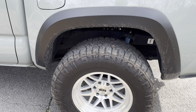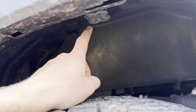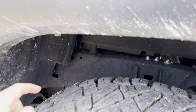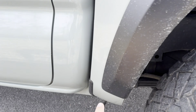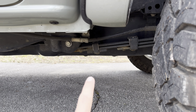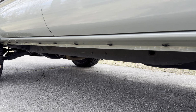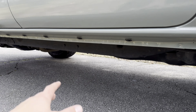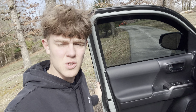Now, when it came to mounting the back, I'll say that mounting the actual lights up into the wheel well was simpler back here, but what made it harder was having to run the wire, because you have to run it from the light behind the wheel well, then into the frame, and then along the underside of the frame, and you have to make sure that it's all zip tied up and not in the way of any moving parts or the exhaust or anything like that. But besides that, the overall install for the lights was really simple. And like I said, I will leave the link in the description below to the actual install video.